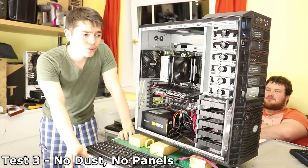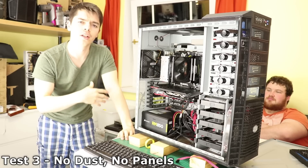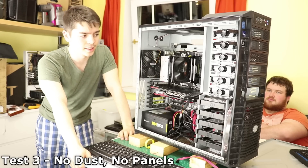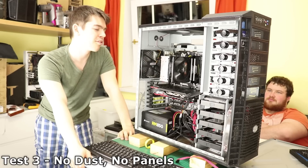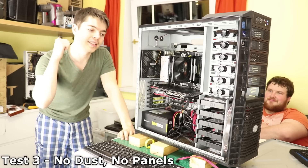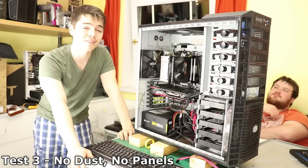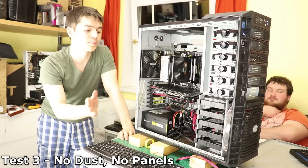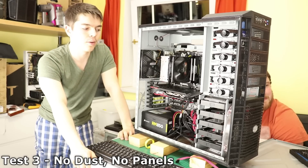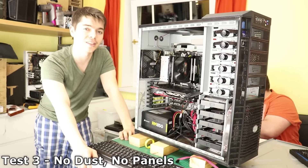We've done the whole cleanup. We're now doing the next test — no panels on, full clean build. Then we'll put the panels on afterwards and rerun the test. Joe's thinking between one and five degrees improvement; I'm saying one to ten degrees, based on the open-air test bench result with the Hyper 212 EVO on the 6700K where we got under 70 degrees. Whereas with this rig, the same cooler with a 90-watt-ish CPU was completely thermal throttling.